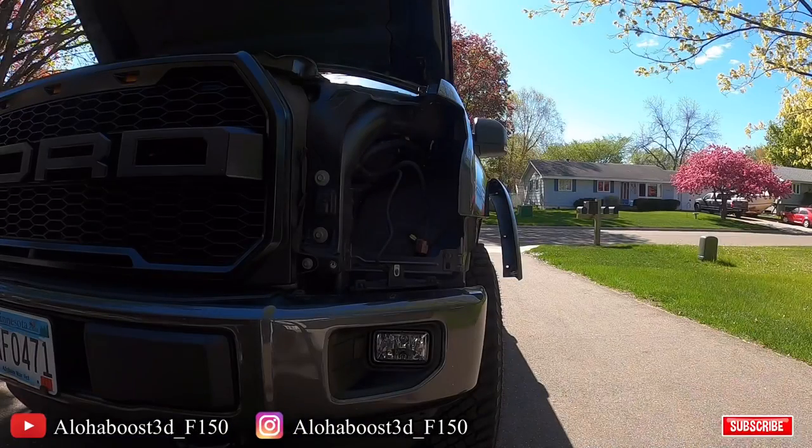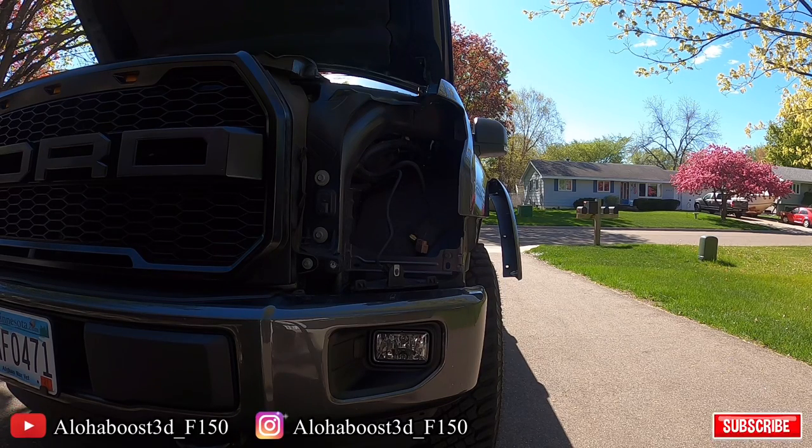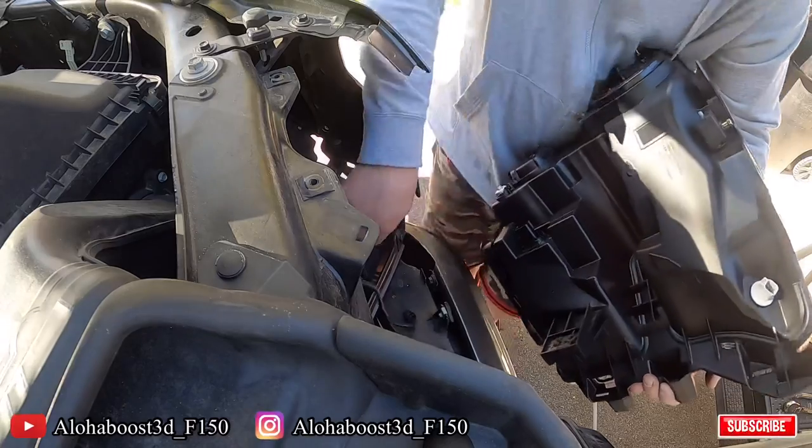All right, so now we're just gonna put the headlight right back into place, put in the 3 10 millimeters to hold it into place, and then we'll do the reinstall, just working our way backwards. We're gonna be putting in the connectors.